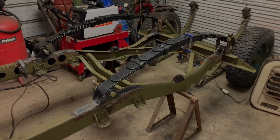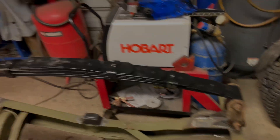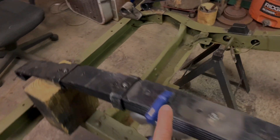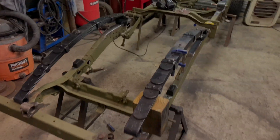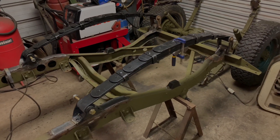I'm going to wrap this video up here — it's almost one in the morning and I've got that guy coming for the 4Runner. So here's what I got done: the rear springs are completely laid in, welded, and set up. All the geometry back here is done and correct. The wheelbase is set at 80 inches on the money. I modified the leaf springs a little bit to accommodate my new axle setup. It doesn't seem like a lot, but it's a lot of thinking and measuring. I'll catch you guys in the next video.